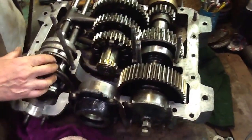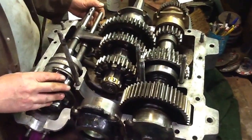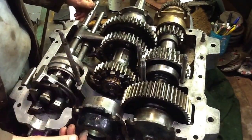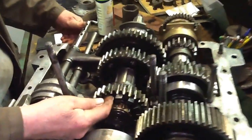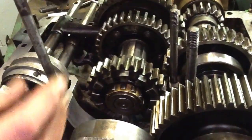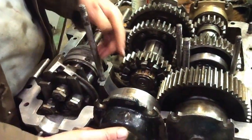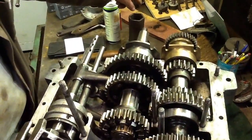When you want top gear — in most bus gearboxes that's fourth, same as in most cars — the bit that it engages with is away being repaired, but it's effectively another set of teeth that mesh together. That gives you a direct, same-speed drive between the engine input and the output to the back axle.